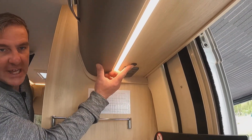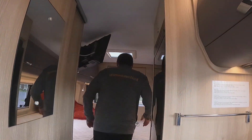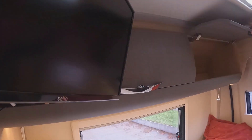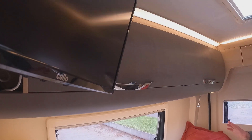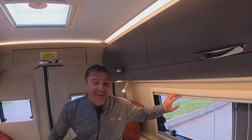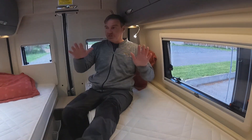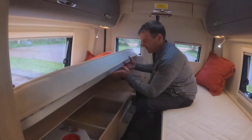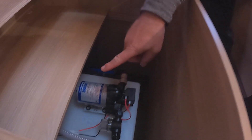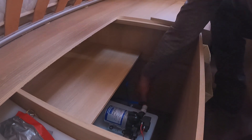There is a fan on the fridge — if you just see that button there, that's the fan. That's more for when you're in hot countries and you're travelling around. Moving away to the back — we've got good storage here, and I do like these cupboards, really nice cupboards, good size. And then we've got the two single beds. The LED lighting isn't flashing — it just does that on camera. We've got our fly screens and blinds, and two good size single beds. Underneath, we have our fresh water tank, and down there that's our pump and our fresh water drain off. If we turn that to 12 o'clock that'll drain the water out, then turn it back to three o'clock that closes up. So you're pretty much winter-ready — with your fresh water inside, if you leave your waste water drain open, that's not going to freeze up.